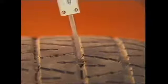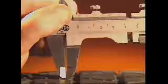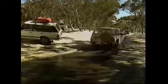Most passenger car tires have tread wear indicators moulded into the tread pattern. They generally provide an indication when the depth of a tire groove falls to one and a half millimetres. Control of a vehicle in any weather conditions depends finally on frictional forces generated between the tires and the road surface. On a dry road, a smooth rubber surface can provide a high coefficient of friction, sufficient to maintain a degree of control during braking, accelerating and cornering. In wet conditions, the coefficient of friction between a smooth tire and the road surface falls to an extremely low value. Grooves in the tread pattern clear water away from the contact patch area, allowing a relatively dry area to be formed and road adhesion to be maintained.